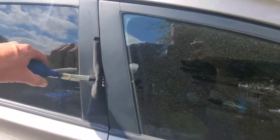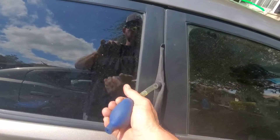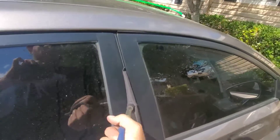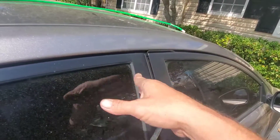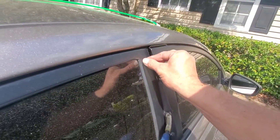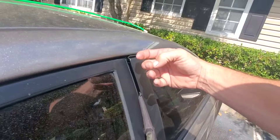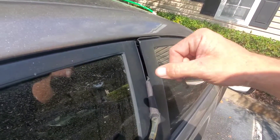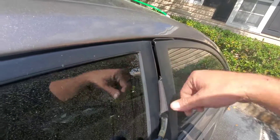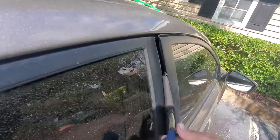Once you get the airbag in the door, close your valve and then pump it up. If you're going to use a wood wedge or a plastic wedge, put some tape on the door right here before you start wedging it, because this little film — especially when it's hot out — will just tear so easily. And if you get your fingernails on it, even short fingernails, it's still enough to scratch it, and there's no fixing it once it gets scratched. So just be careful with that.